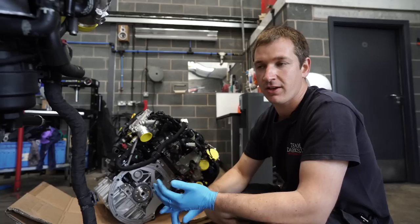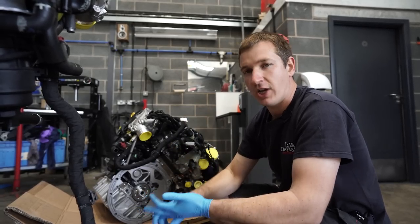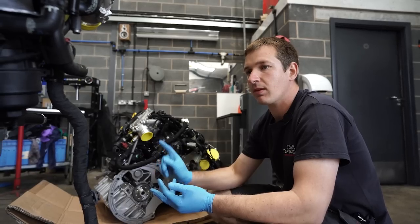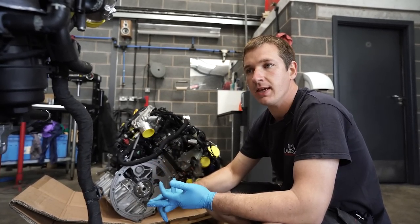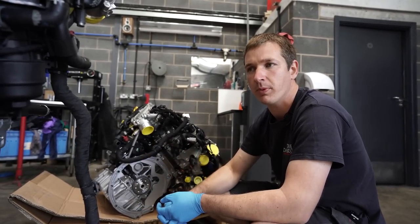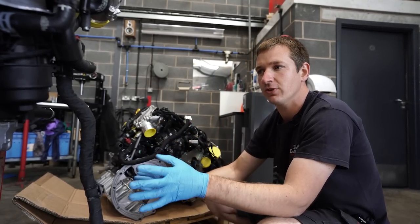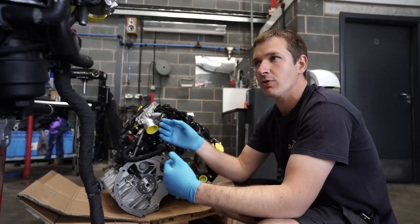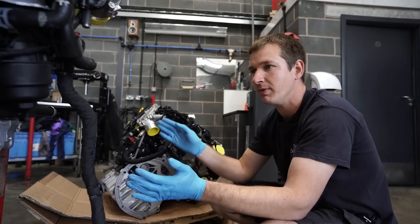We've got a crank trigger and a cam trigger to sort out, because that's on the cam on these, so we've got to put one on the wheel. We've got the injectors to put in, because we're putting solenoid injectors instead of the piezo. And we've got the electric water pump to sort out, because we don't want the electronic sleeve that seizes up and gives hassle. So we put, I think it's a Transporter water pump. The variable oil pump, when you unplug it, is just at full, so that's pretty good, and it only limits it down so that it's not pumping too much at low loads to try and get the efficiency up. It's not something that you need, because that's where the regulation comes from.